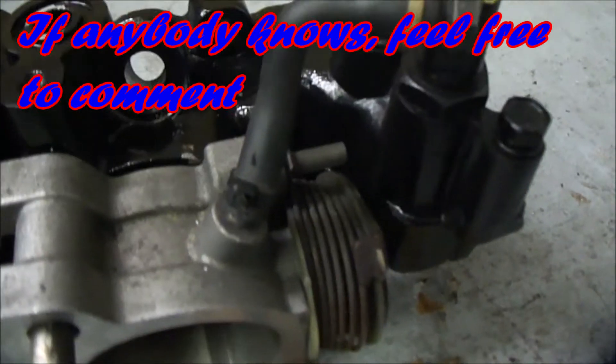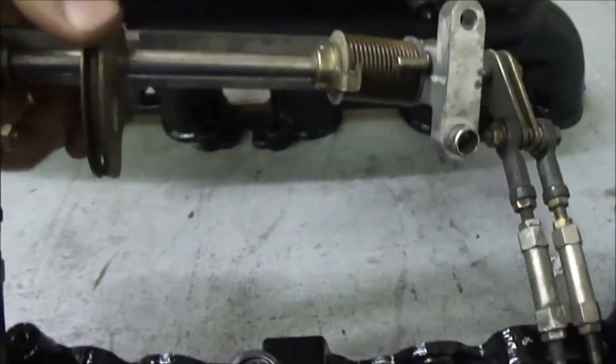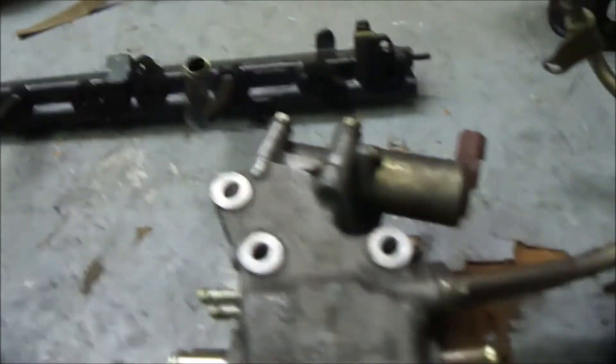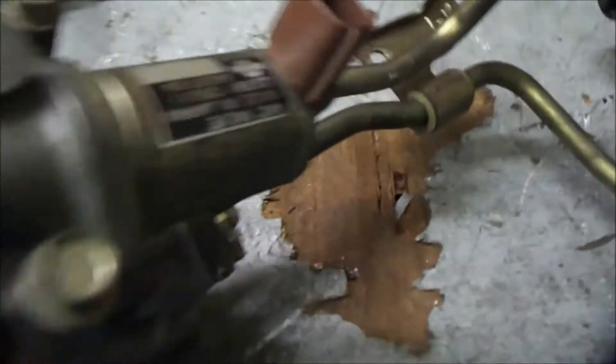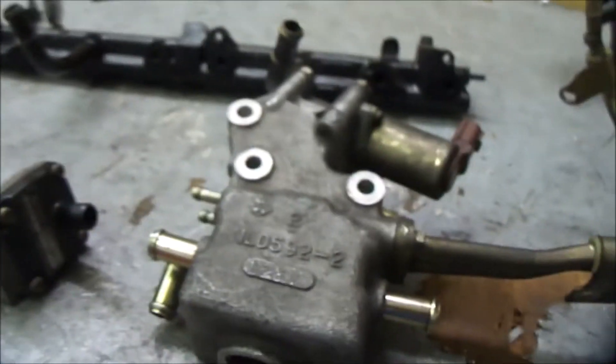This being one — I'm not sure where this originally went to on the GTR, but it was blocked off prior. So this is just a TPS, and this mounts to the intake and you have adjustments here for your throttles. This again is a balance tube — it's basically to get an accumulation of essentially manifold absolute pressure from after the throttle bodies. This, of course, is your idle control. This here goes to this here, and I've stated the rest of where, as far as we know, those rest of the vacuum ports go.